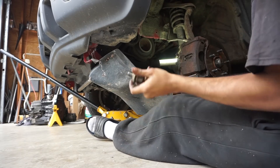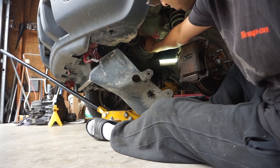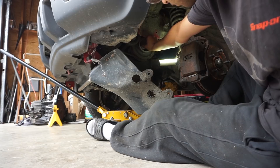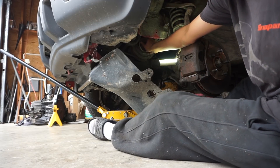See how it came out perfectly? We're going to thread this back in — we're not taking that off until a little bit later. I like starting here because this bolt will hang you up if it's seized.